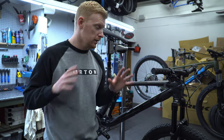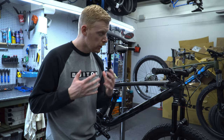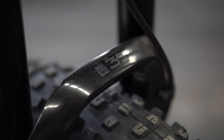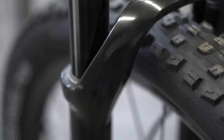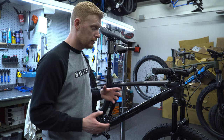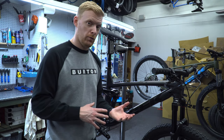Let's jump straight into the specs. Out front, they have the RockShox 35 Gold RL — a 35mm stanchion fork at a high performance level. This is a really good front fork. It has an air spring, so it's adjustable just with air pressure. That takes the weight away, it's light, and overall it delivers high performance.